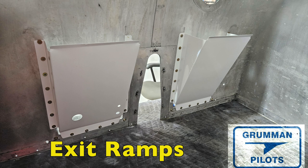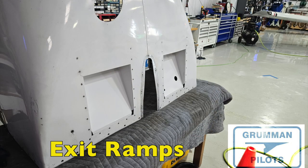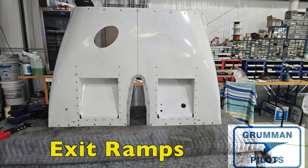Here the pop rivets are all coming into place on the air exit ramps with the little washers inside to hold everything in place — all primed and painted and ready to go. Now that the exit ramps are done, we're going to mask off the cowling and paint the inside with Imron white or polyurethane white. That way, should you ever have an oil or fuel leak in the engine cowling, it shows up against the white very easily.